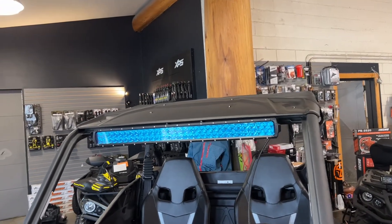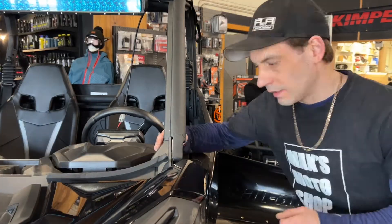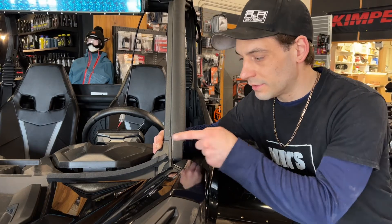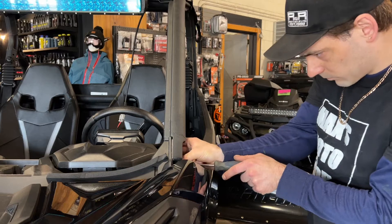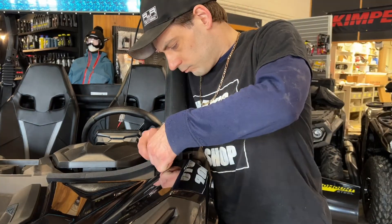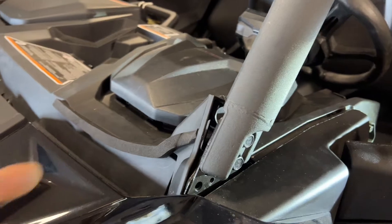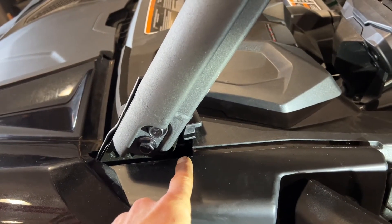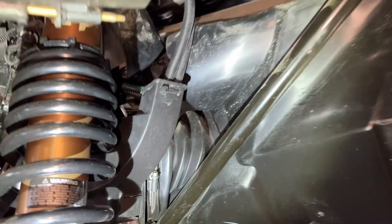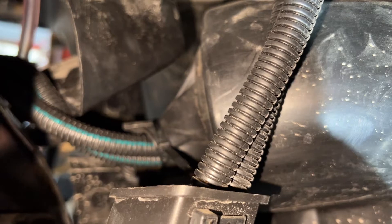Now I can start on the wiring. To route the wiring, the first thing I'm going to do is pop off our window here. Now I'm going to remove these two Torx 25 screws going in from the side to take off this little plastic cover so that I can run the wiring up from the bottom. As you can see I only needed to pull back this plastic cover a little ways, and this will give me more than enough room to sneak my wire up right there. From the driver's side of the vehicle you'll see there's a rubber boot going through the firewall right there — I'm going to cut the zip tie on that rubber boot, stick my wire through there, and then I'm going to follow the frame up and out that hole that we just exposed.